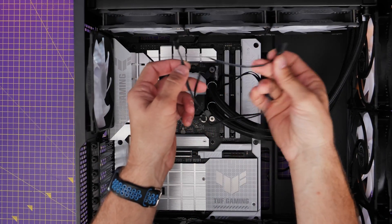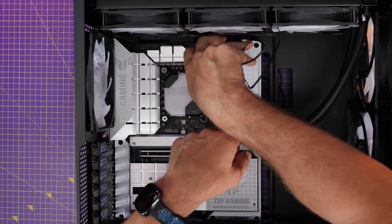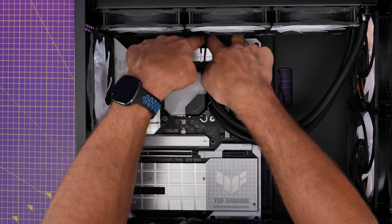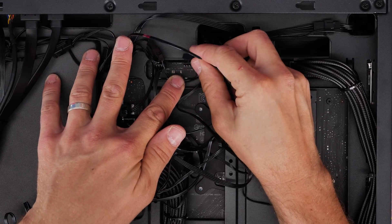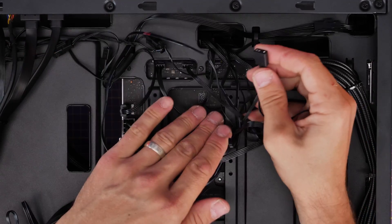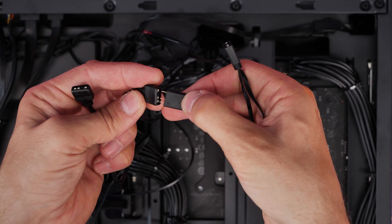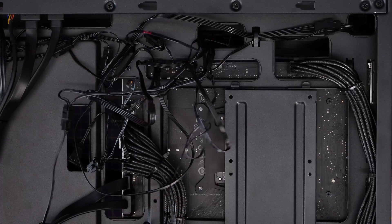We've got those other cables to connect: the fan cable goes to the AIO pump header. Then you have the female and male RGB connections from the pump, which we can daisy chain onto the fans. Make sure at least one of the connections — either from the fan or from the pump — is connected up to the motherboard's 5V RGB connection, and then both the fans and the pump will receive that RGB signal.